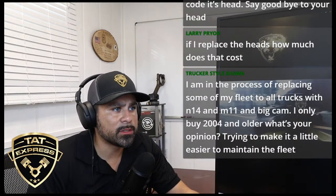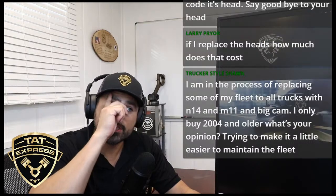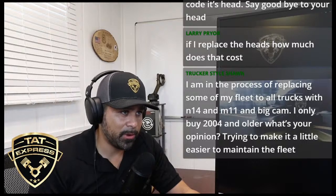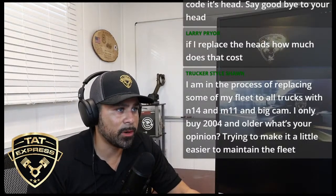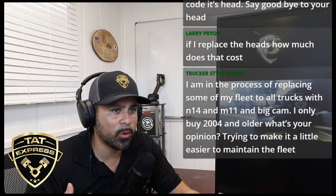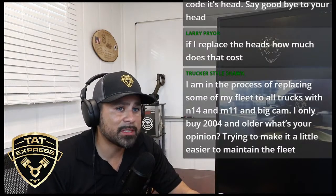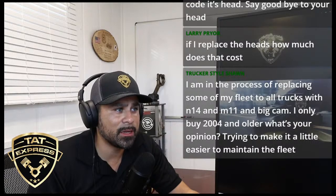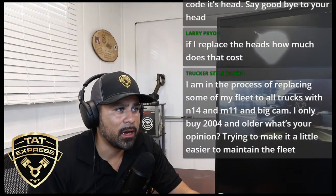Why does the motor vibrate at low RPMs? Check the motor mounts, and if it's a DD15 with the up and down type of idle, then that's going to be your quantity control valve. Sorry, and if it's got high mileage, go ahead and replace the whole pump. I'm sorry to have to say it, but sometimes if you have issues with that pump, you'll have to replace it.